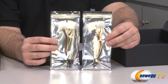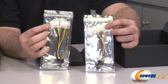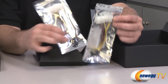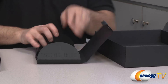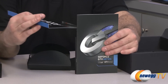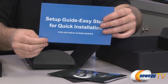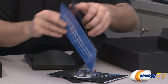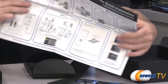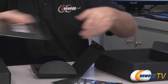You get two power adapters here. Both have two four-pin Molex plugs at the top, and they'll convert that to a six-pin PCI Express power plug. So if your power supply does not have PCI Express power plugs, you can use those to adapt it. You also get a setup guide — easy steps to set up your graphics card from Galaxy — which folds out and gives you a nice easy walkthrough for installing the video card if you're not familiar with that process.